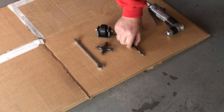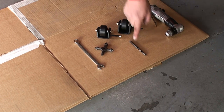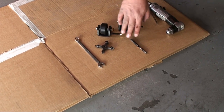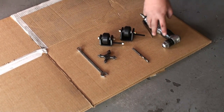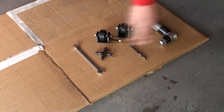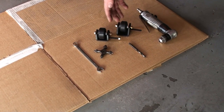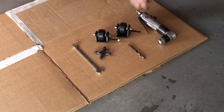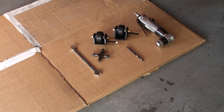The only drill you need is essentially a 5/16th drill. I'm going to drill a pilot hole — I just think it's easier because you're underneath the car. I'm also using an angle drill, which some guys might say is cheating, but you can use a regular drill. Obviously if you don't have a floor jack you'll need to get it up on blocks, since the Corvette sits a little bit low. But this is all it really takes to install a nose saver.